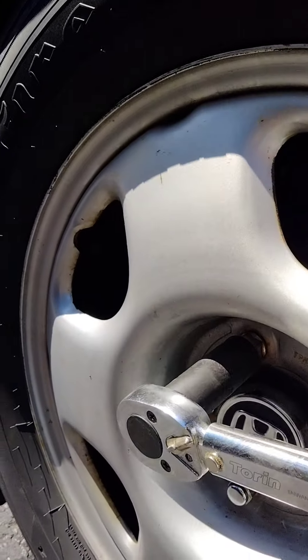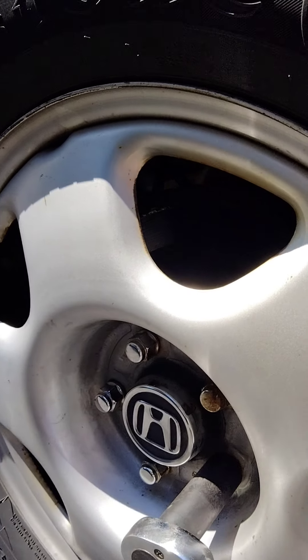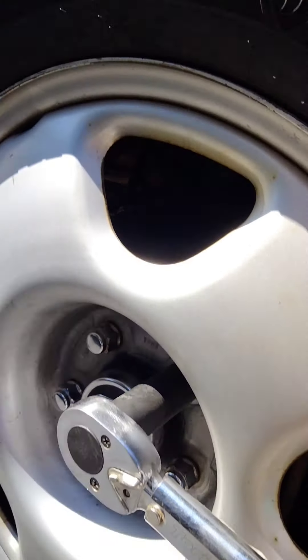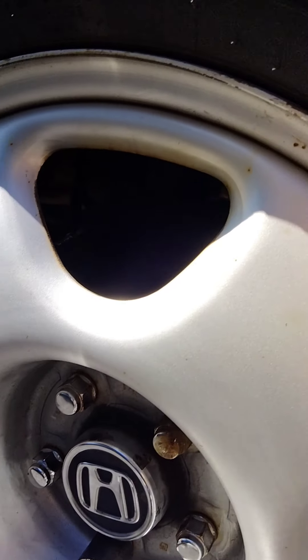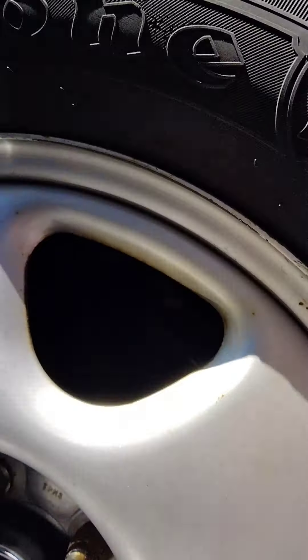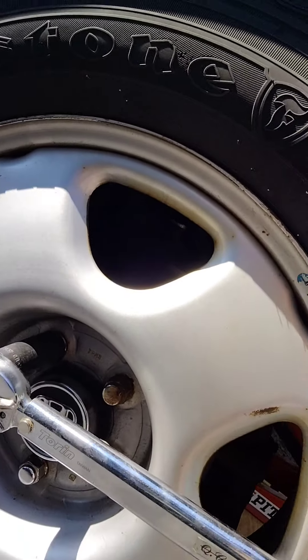This second jack stand is out. Now I can lower the rear very, very gently. You can see the wheels coming down slowly — it's already touching the ground on both sides. I'm not putting all the pressure on the ground yet — just enough so it doesn't rotate when I'm tightening the lug nuts. Now using the torque wrench, I tighten in a star pattern again. Going around each one to make sure they're actually tight — each one clicks at the correct torque. Once you've gone around and all five lug nuts are torqued, these are tied to the right specs.